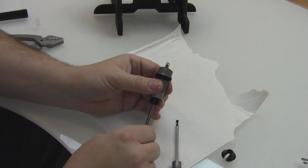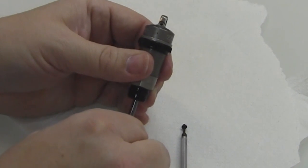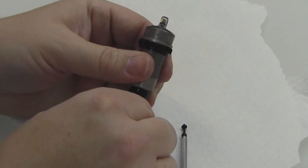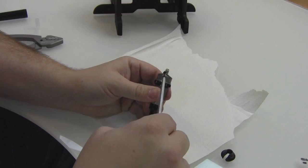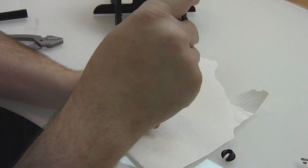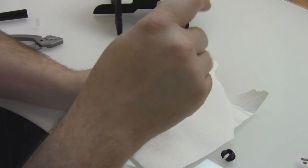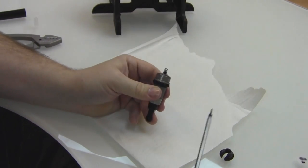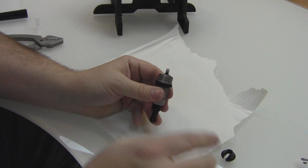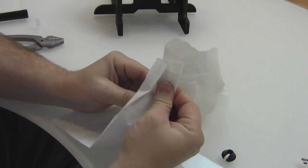To do that, I hold it at a slight angle as you see it here, and I run the shock through its range of motion just up, and I should get a little bit of shock oil to come through. Once that's all the way bottomed out, I put the screw in there. Don't go gorilla on this, just tighten it down enough to make sure that it's not going to come out. Wipe the oil off of the cap.